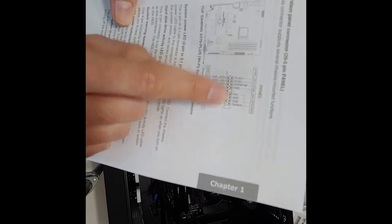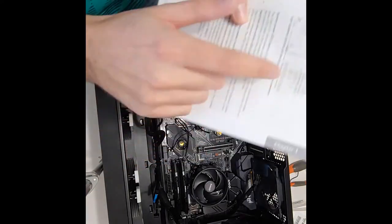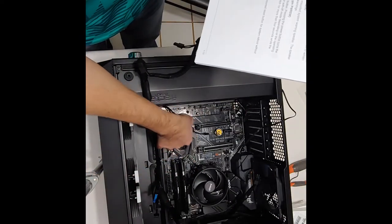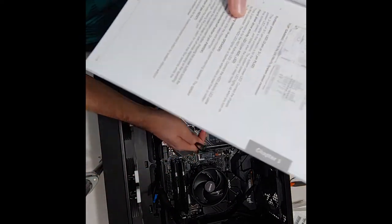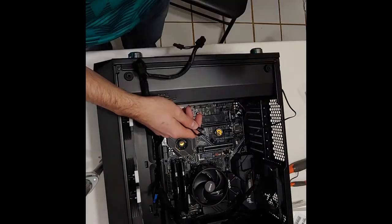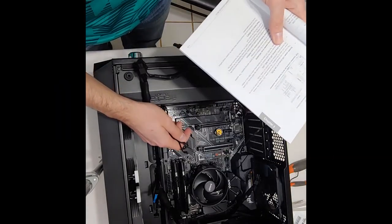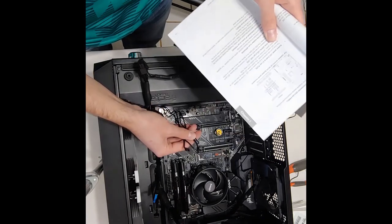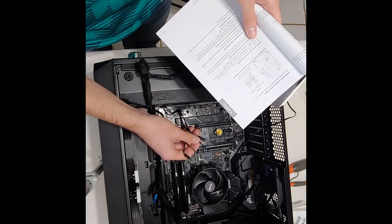Positive, negatives, grounds, empty spots. You know, for example, there's a speaker option here. My case doesn't have one. My old one did. It would just beep and yell at you when something went wrong. It'd kind of give you BIOS update and kind of status. This particular motherboard itself has a LED blinking system, so if there's any issues, it will just blink specific colors and patterns at you to identify them.